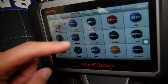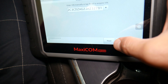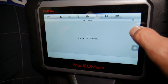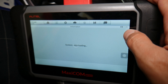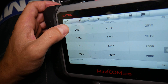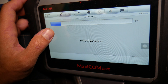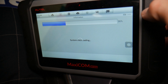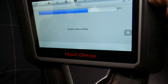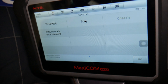Now it's going to read the VIN number — Chrysler USA. We'll click continue and then OK. Make sure that the voltage is up too, because if the voltage is low the diagnostics will not work correctly. Try to keep it over 12 to 12.5 volts; sometimes you may need to connect a charger. We have a Dodge Challenger here that we'll be working on. It's loading all the different computers and programs. Let me show you how many computers that car has — under Power Train, Body, Chassis, and Info.